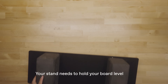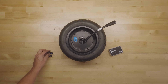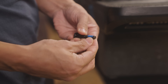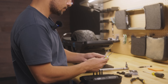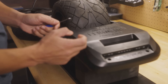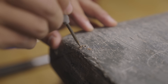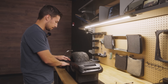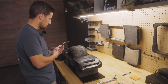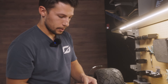Some of the things you'll need: a stand, a board, and a GTS motor. Having some spare hardware is always nice. You definitely want fresh axle bolts with anti-vibration paste. You need a torque wrench and a Torx Plus 45 bit, an electric driver, and a pick. These bumpers contact the ground and plastic can wear over the screw, and you can get dirt and debris in the screw. Also good to have a rag — make sure you're cleaning off where you're placing the screws for a clean, even surface. Even a little dirt underneath the screw, if it works loose over time, the screw could come loose.